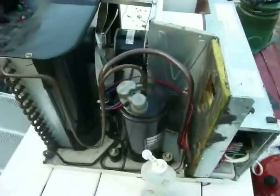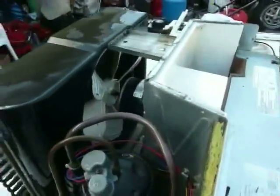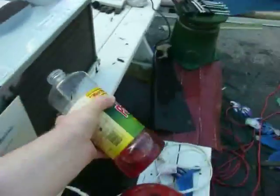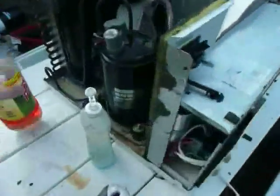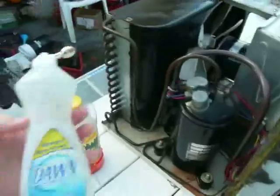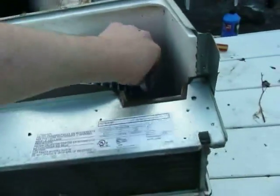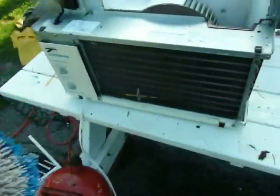If your air conditioner is truly nasty enough to need it, use a little bit of mild cleaner — just pour a little bit in around the various areas of the unit. You can use pine cleaner, which might have the added benefit of deodorizing your air conditioner if it's stinky, or you can just use some kind of dish detergent. You don't want to use anything particularly abrasive — no fuming sulfuric acid, benzene, paint thinner, or any of that stuff. Then just go over parts of it with a scrub brush. If you use this on the coils, be extremely careful, because they are made of very thin metal and it does not take much to crush them flat.